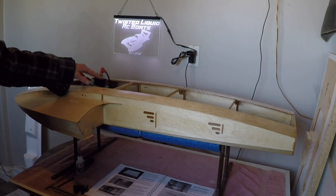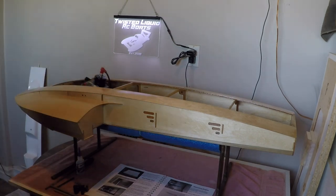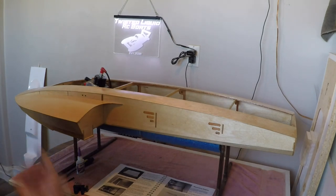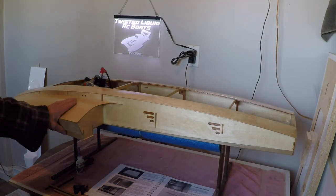When I reposition the camera, you're going to notice that I have a 1/4-inch wooden dowel, approximately 6 inches long, in the collet of the boat right now. That's going to act as our drive shaft while we are installing our stuffing box and using our stuffing tube for alignment. So I'm going to shut the camera down, reposition it, and we're going to install the stuffing box in our Zippkits SLR missile Thunderboat today.